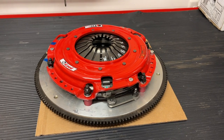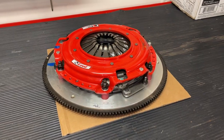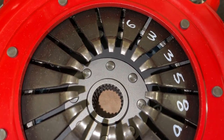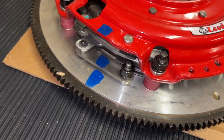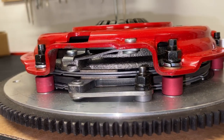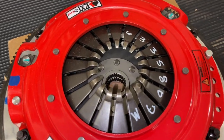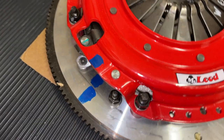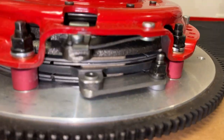Here's what it looks like. I have the aluminum flywheel bought from McLeod as one kit — they also offer a light and steel flywheel. Looking down through here you can see where the input shaft from your transmission would go, again 26 splines on this one. You'll also notice the alignment marks. The installation instructions state all assemblies should be balanced to the flywheel you are replacing; the twin disc power pack assemblies are not pre-balanced from the factory. Allow 1,200 shift cycles for break-in before hard driving, and balancing must be done on the flywheel only or it will void the warranty.